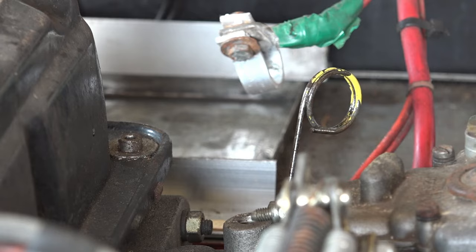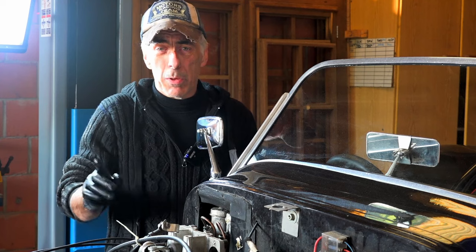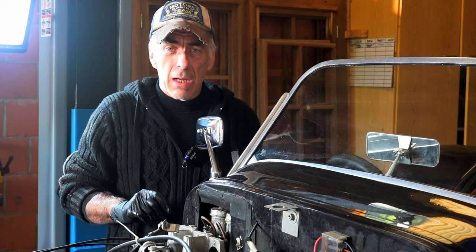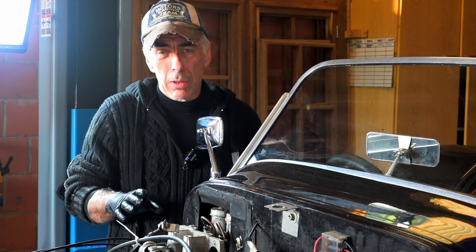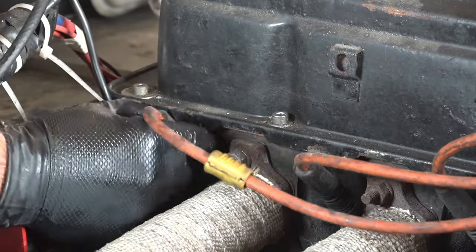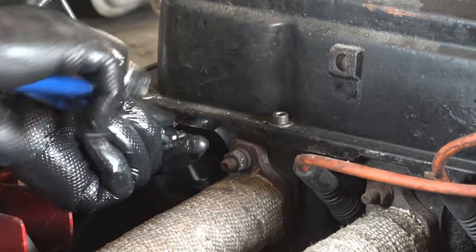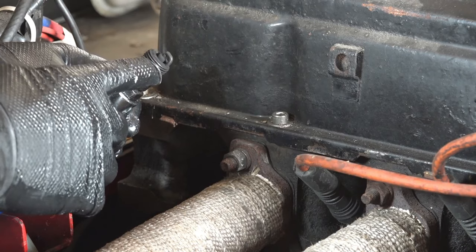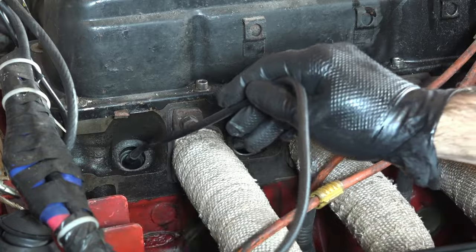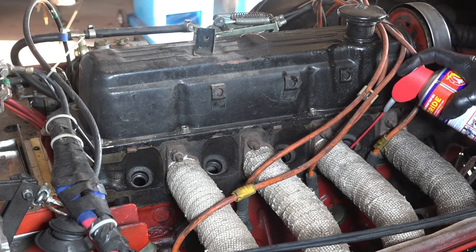Also check the cooling liquid and see if there is any water inside the oil. The next thing we're going to do is remove the spark plugs and look inside each cylinder with a small camera to see the state of the cylinder. If it's badly corroded then it's not worthwhile to continue and even crank up the engine. You might as well check the state of the spark plug itself, because that can tell you a lot about the state of the engine.